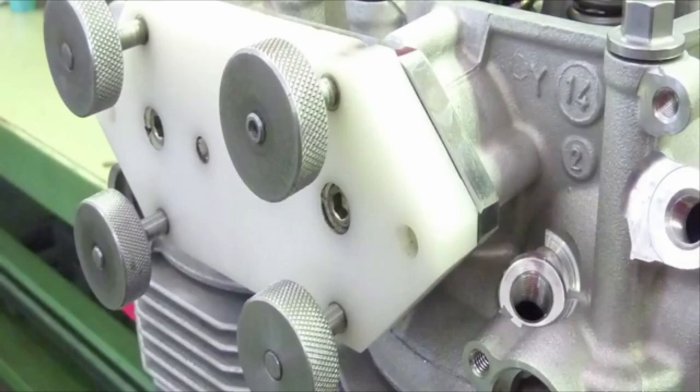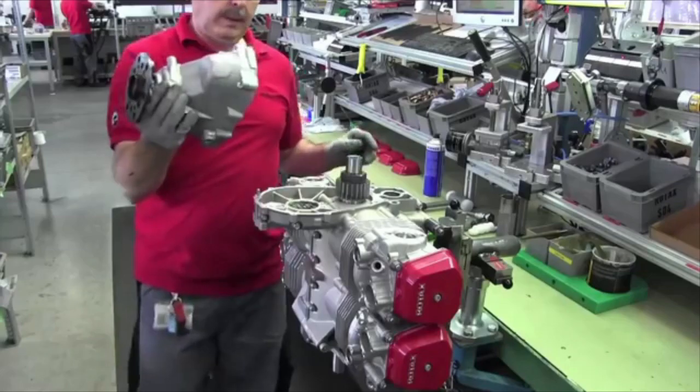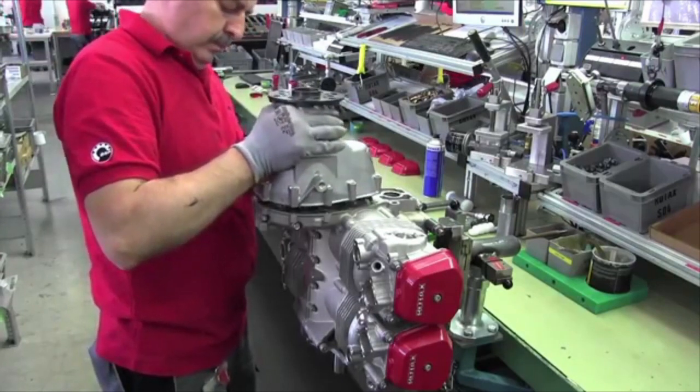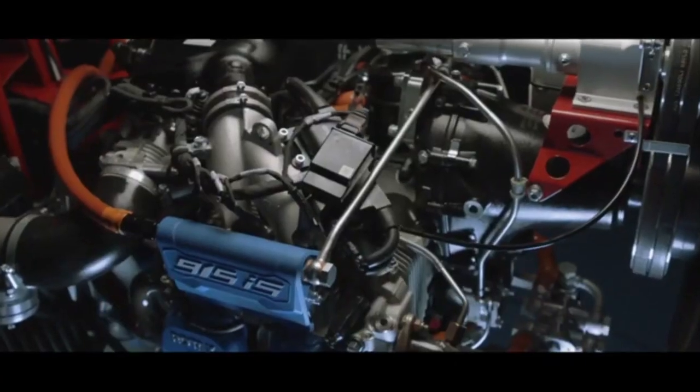The first number to clarify, perhaps for people not familiar with Rotax engines, is the power figures. The 141hp headline is only available for up to 5 minutes, and effectively becomes the take-off power, while max continuous — available all the time — is 135hp.